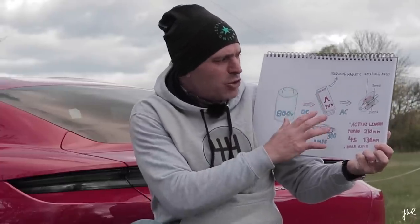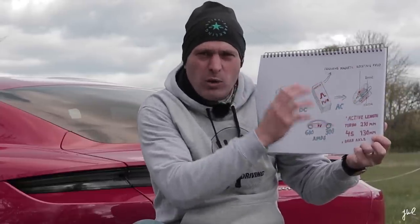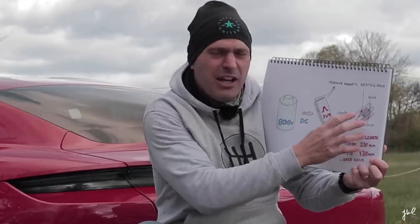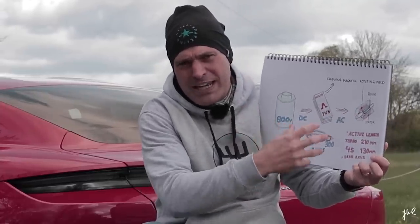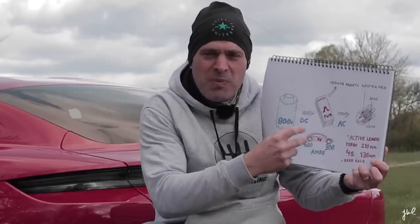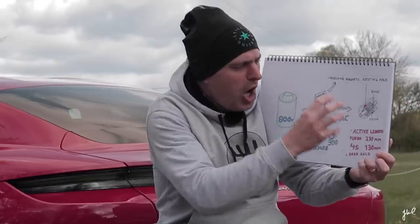So let me try to go further, because the frequent magnetic rotating field that the inverter creates also affects how compact the magnet in the electric engine can be. Therefore, the wiring in the stator, in the electric engine, is extremely important, how compact you can wire it up. So in the Porsche electric engine, it's a more squared and twisted form, making it more compact.